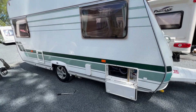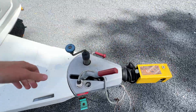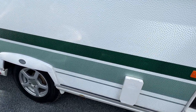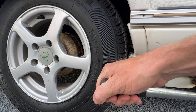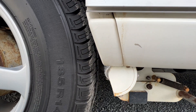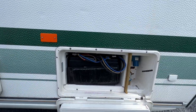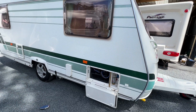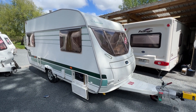Once you've finished moving the caravan, we just work that process in reverse. We're going to come to the handbrake and pull it back up, because the motor mover is no longer going to be holding it in place. We simply put our handle on the opposite side and turn it the other way, and you'll notice it's going to disengage. The handbrake is now holding the caravan in place and we can turn that off. The remote will automatically time out after a certain amount of time. And there you have it — that's how you use PowerTouch motor movers.